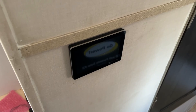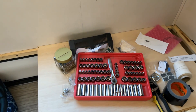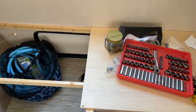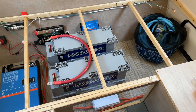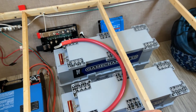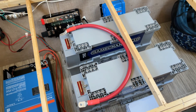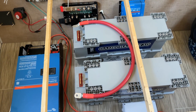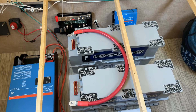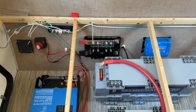Over the weekend I went and got the Touch 50 display installed. This is going to be for the Cerbo GX control panel. Everything's coming along nicely - everything's ready to go. So I've got ordered some 4/0 cables for the inverter and for the batteries. This is just one that I had left over from my project, and I was using it to test bend radii and mock up and measure lengths for having all these custom cables made.